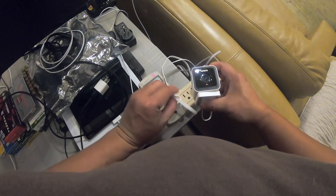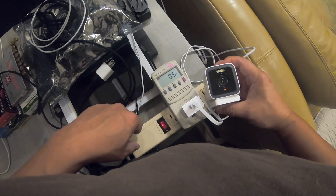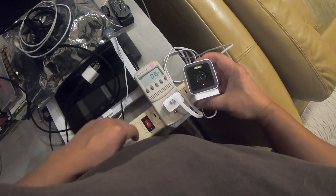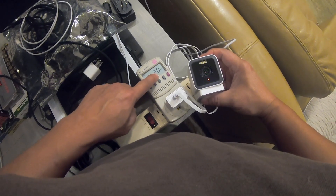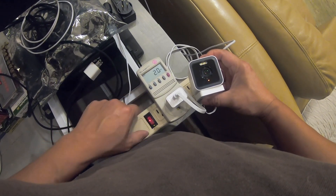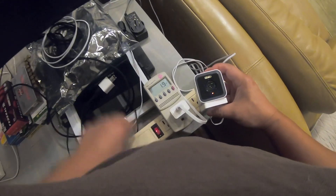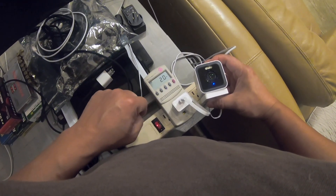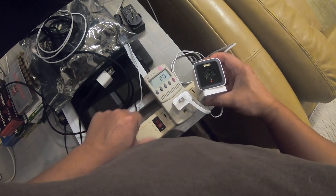I've got the Kill-A-Watt here. As you can see when it's turning on it's about 1.2 watts, then it went down to half a watt while it's still booting — the red light is still on. Then it starts increasing: 2 watts, 1.7, 1.9, 2, 1.7. I think it'll turn blue once it's completely booted up. Right now it's at 1.82 and hasn't passed 2 watts yet.